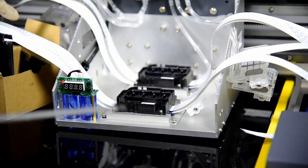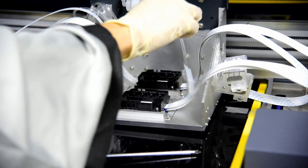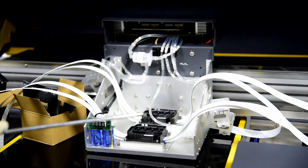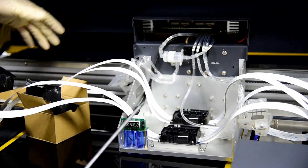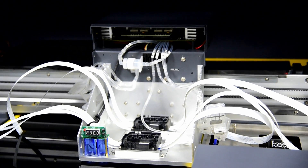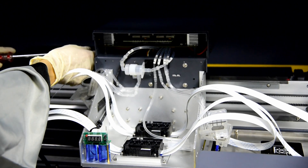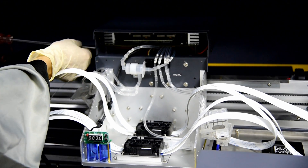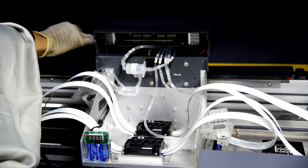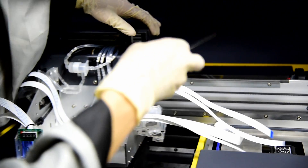We're done. These print heads are installed. Now we start to install the print head cable with the printer. We need to open the carriage cover by loosening four screws — one, two, three, four. We loosen them but don't need to take them out completely. There are four screws: two at the left and two at the right.